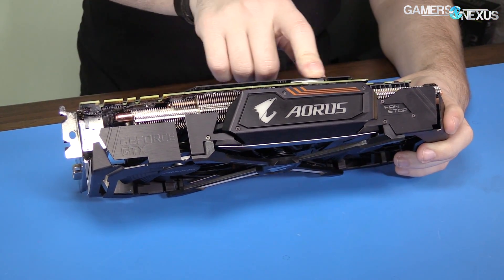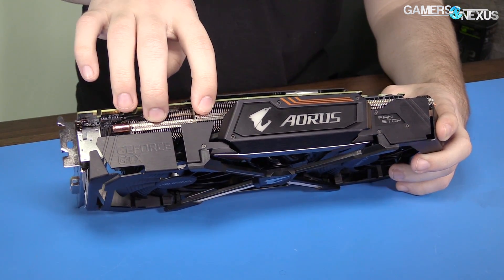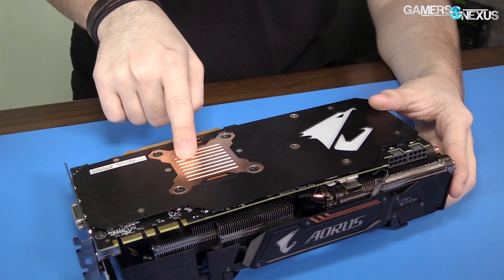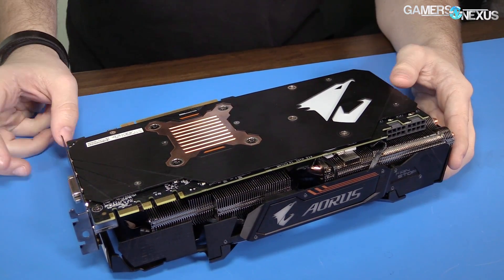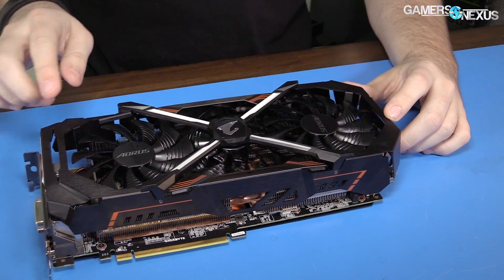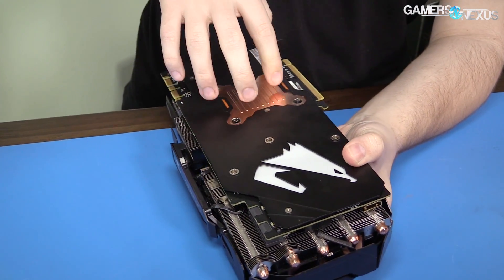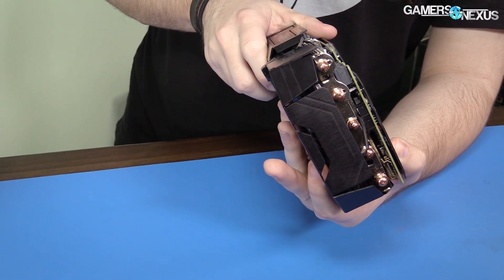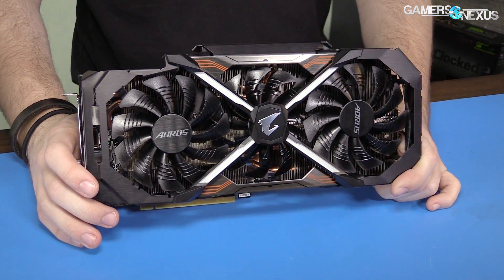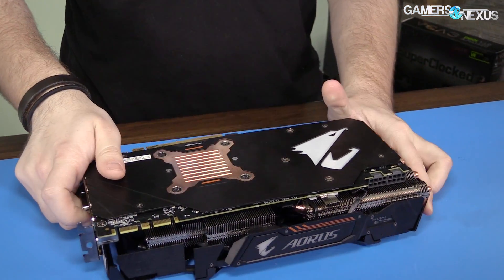Normally back plates are primarily for structural support, and for something this large it makes a lot of sense — you've got a massive cooler with a huge dual set of aluminum heat sinks, the base plate, and the cold plate. You want some kind of support to keep it straight and prevent sagging. The fact that they've added a thermal copper section means they're also trying to do something thermally. There's LED stuff going on as well — LEDs here, LEDs in the crossbars on the front. We've got a set of five visible heat pipes, probably more towards the inside. They look to be six, maybe eight millimeters. And looking down the center, there appear to be two or five millimeter thermal pads in most places, which are pretty large.